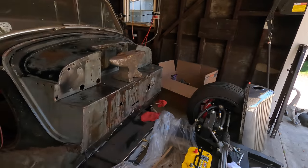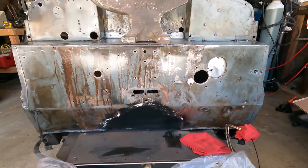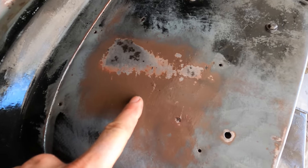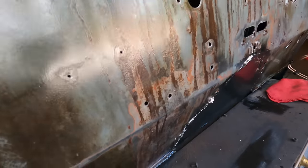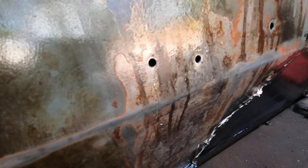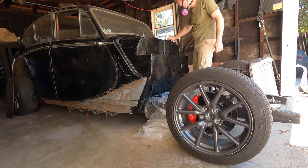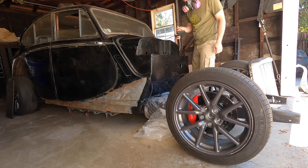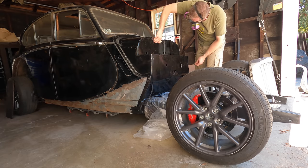I'm not going to get this down to the bare metal, but I do need to get off all the rust and all the black paint. This car wasn't originally black — it was a gray color. Somebody repainted it at some point and didn't do a great job. I wiped this down with some rust converter just to make sure all the rust was neutralized, and then I put some SPI epoxy primer on it. This stuff is great — super durable, self-etching, and it has UV resistance so I don't need a top coat. Typically you would spray this on, but I'm just going to brush it on. It will leave brush marks, but this whole area is pretty rough so it's not going to matter.